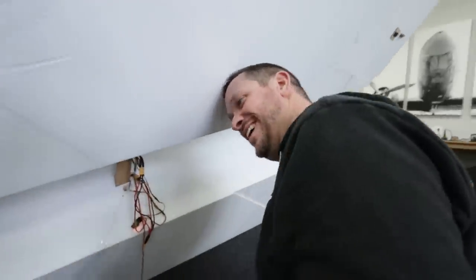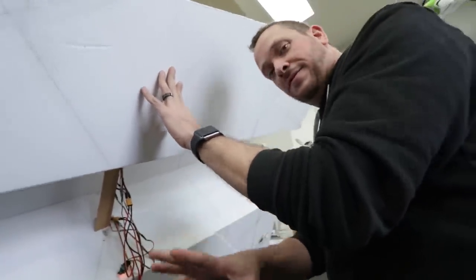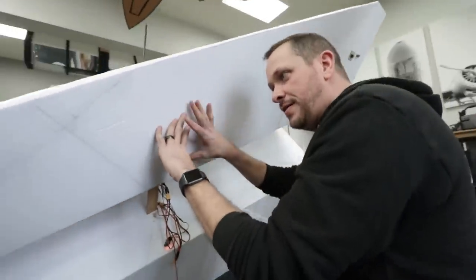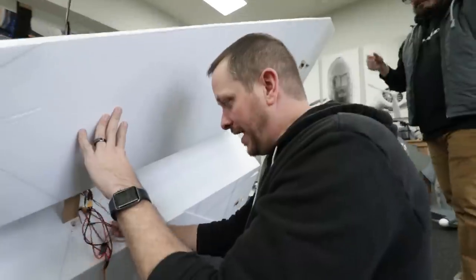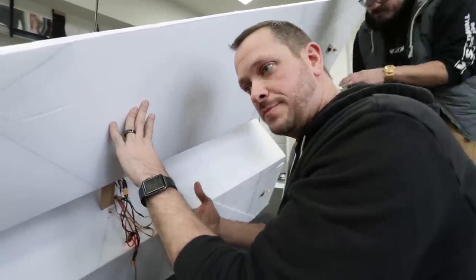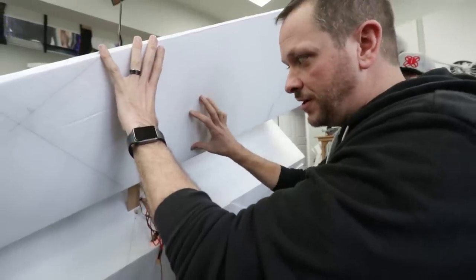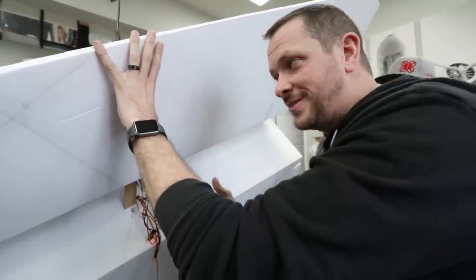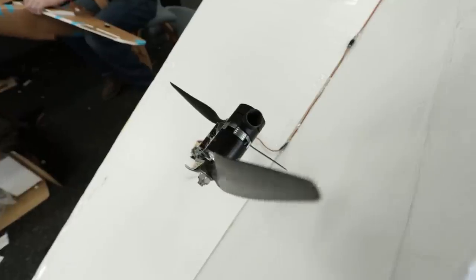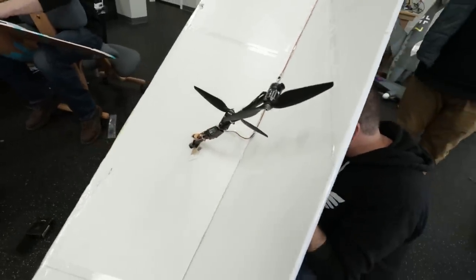You like my prop here? Yeah, man, what are you doing under here? So we're powering this up here. We got two motors going into Y, but we have four motors total, ganged into two on the left, two on the right. What we have now is differential thrust, and I'm gonna go ahead and test that out, make sure all the motors are spinning properly. It sounds weird, but we need one tractor, one pusher on each side, so we gotta make sure the props are right and they're all spinning the right direction. Super differential thrust. All right, gonna start my first start.